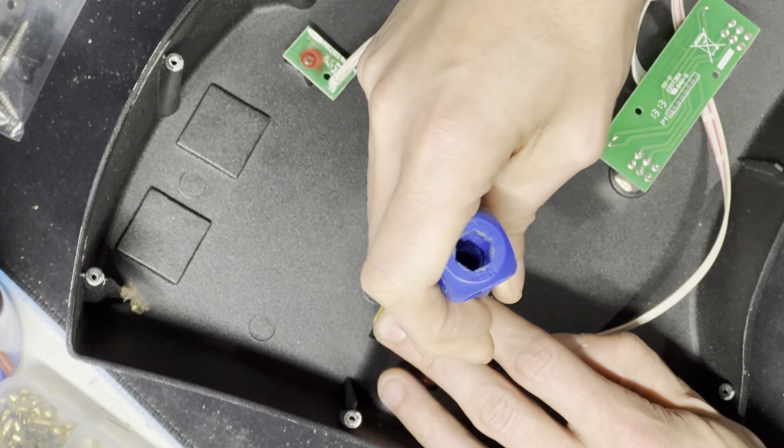So to give you an example, I'm going to zoom back out and show you what I did here. I turned the amp on and connected the cable because I want to show you what we did. Pay attention to this screen — right now it's just showing the name of my preset. So the left one we didn't work on. Look how easy it is to activate the tuner — it was very easy. See that? Barely, just barely. It shouldn't be that easy. Let's say you want to turn your volume up — and it turned on the tuner. That's the problem we wanted to address.